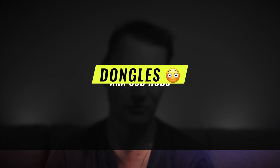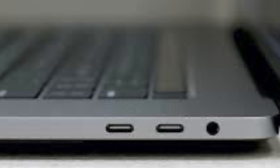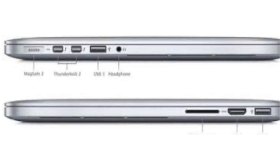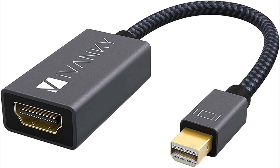First up, the dongles I use. As I explained in the original video, you need one dongle per port per screen — Macs don't seem to be able to support multiple monitors from one port. You obviously need to get dongles that work with the ports for your particular Mac. Mine is a 2019 MacBook Pro 16-inch with USB-C ports, so I have USB-C dongles. If you've got an older laptop like a 2015 model with a Thunderbolt port instead of USB-C, you'll need something like a Thunderbolt 2 HDMI adapter — I'll put a link in the description below if you need one of those.